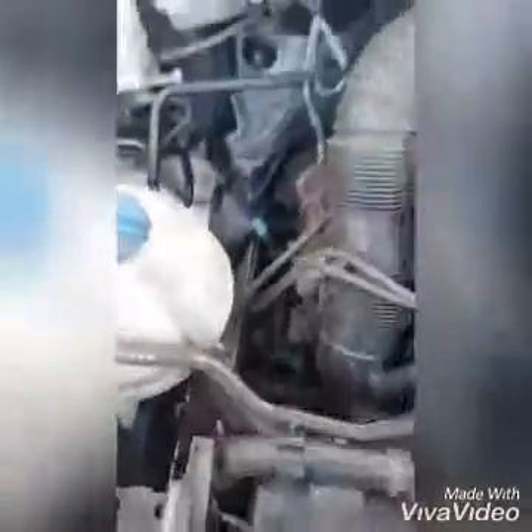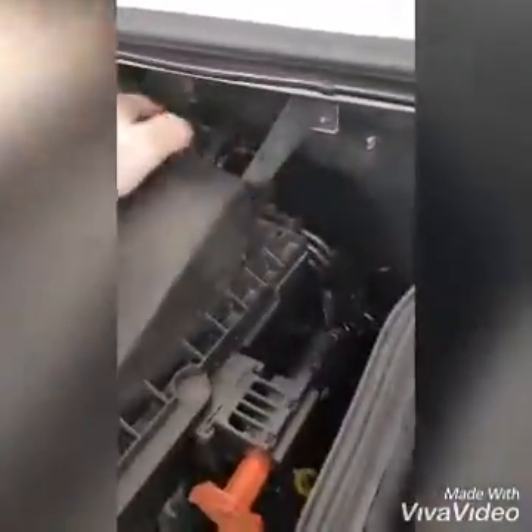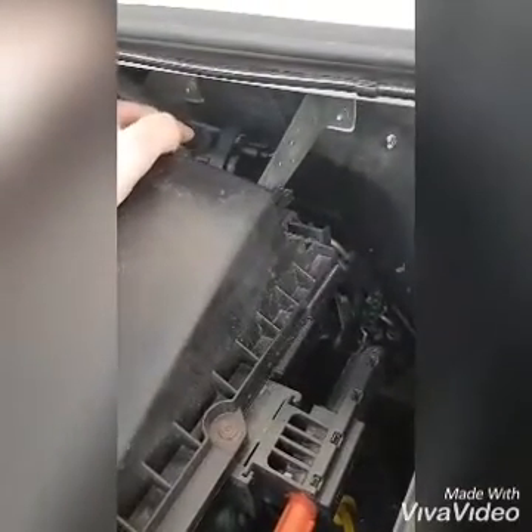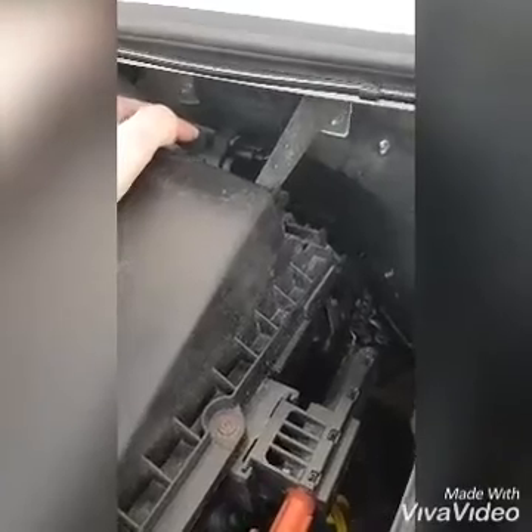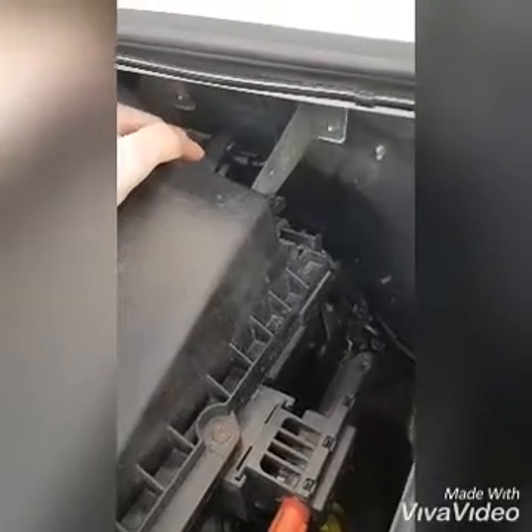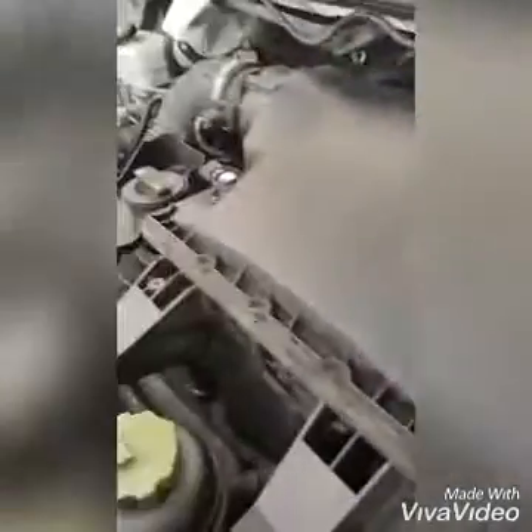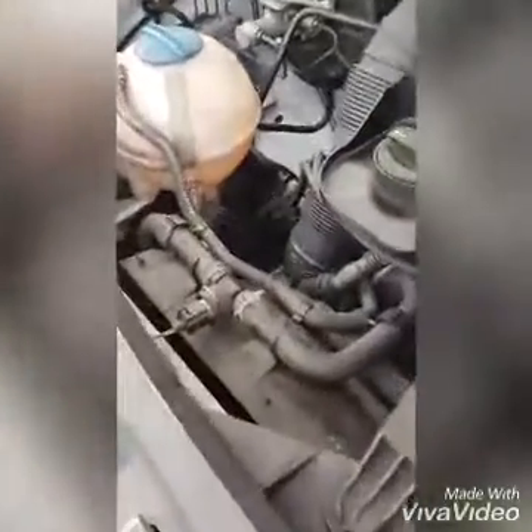Providing your electrics are good and you're getting the power, it'll be the pump that's gone — nine times out of ten. I replaced it, cleared the fault code, and it's gone. With the second pump here, you won't get power to it because it gets power from a temperature switch once the engine gets up to temperature, so a multimeter check on that won't show power. Replace the one down by the radiator and you should be good.